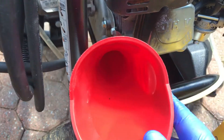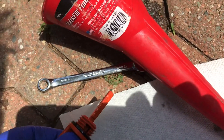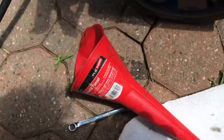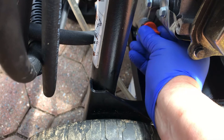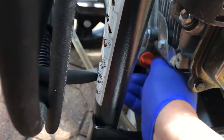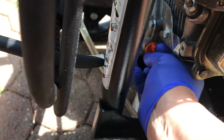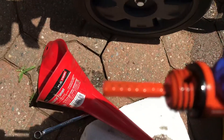Do a little bit at a time. Get your fill cap, wipe it clean — get all the oil off. Take it, insert it in here, give it a couple of twists. This is another thing you don't want to strip, so start it off easy. Snug it, then back it up and take it out slowly. Check it — and we are good, we're full.